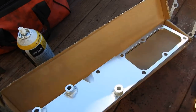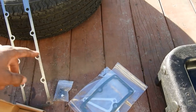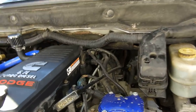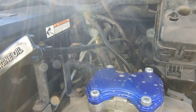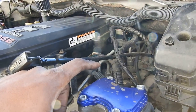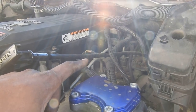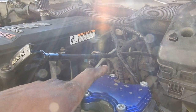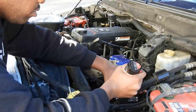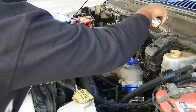Here is our grid heater delete plate - I got this from Rudy's Diesel last summer and I'm just now getting around to installing it. Here's the hardware for it. Now I'm gonna get set up and start taking this stuff apart. It's pretty simple: take the horn off, take the bracket off the fuel rail - you can either fully remove it or get it moved enough to slide the other plate out - but you're still going to remove all the hardware for the fuel rail bolts mounted to the grid heater.